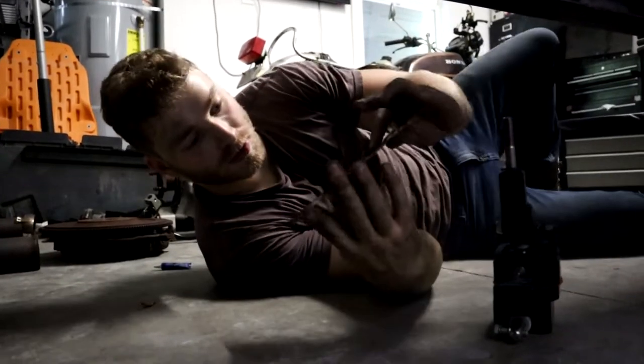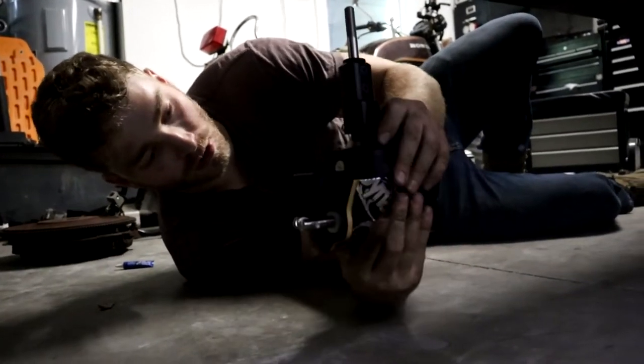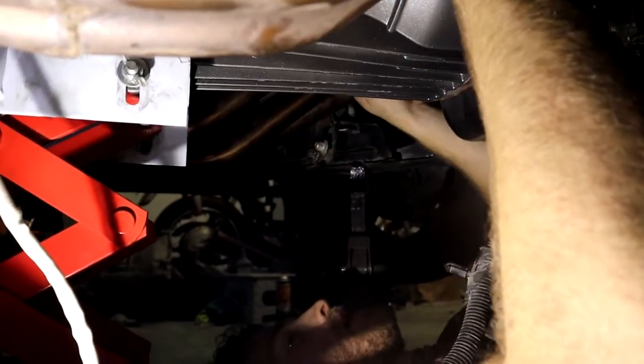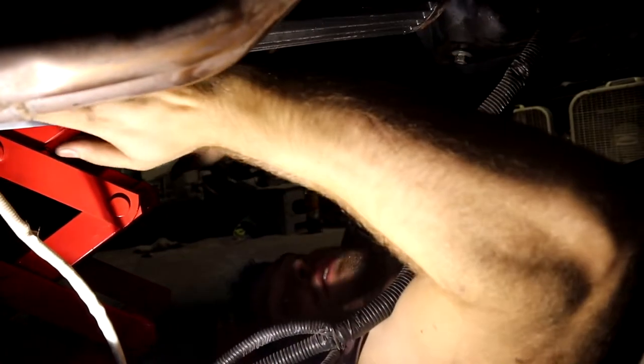What you're supposed to do with the rest of it is wrap up the bottom of our shifter here. However, we have a lot left over, so we're gonna do some more arts and crafts and cut some of the excess. Finish tightening up these bolts, and then our transmission will be beautiful. It'll be perfect. And then we'll put our rear transmission mount that goes across the rear, and then our transmission will no longer need this jack.